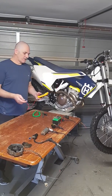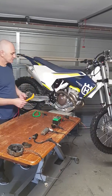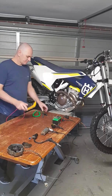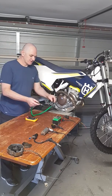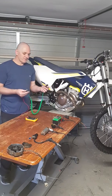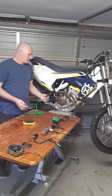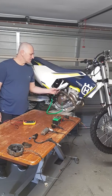G'day. Today I'm going to have a look at diagnosing issues with the electrical system on motorcycles. You will require a multimeter and a test light, or just a multimeter. I prefer to use a test light as well. You can earth it on any part of the bike and just touch it against any positive and it will glow. I find this a lot easier to use than a multimeter because you just need to plug it onto the bike and anything that is positive will glow.